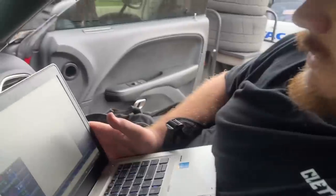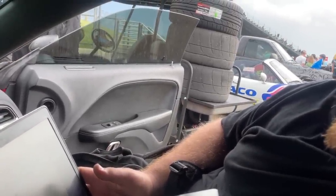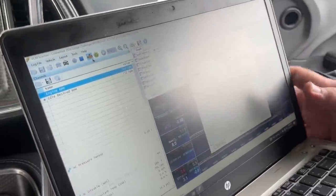First test burnout, and the car shut me down like 10 seconds into the run, which is way quicker than the last time I did it. So we got to tune it all here. We're pulling the code, see what she's doing. We got a supercharger inlet pressure sensor. Supercharger pressure sensor? Like a MAP sensor? Inlet sensor, so it could be. We'll see if we can make an adjustment. We got two EVAP codes. That's normal. And then P026E, P1400. Not sure what those two are, but.